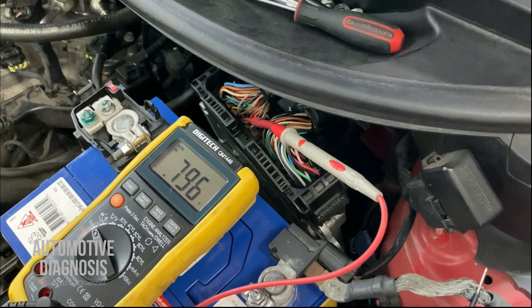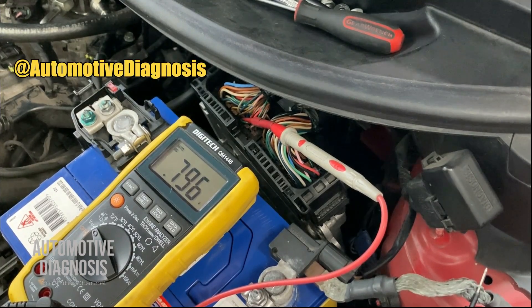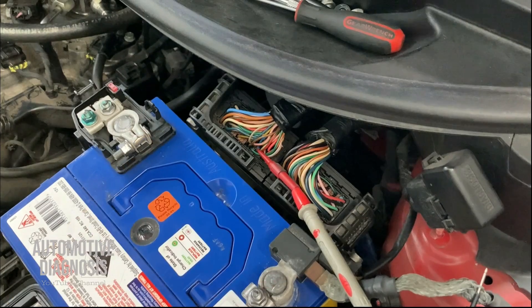If your voltage reading on the throttle body side was exactly correct, but when you check the voltage on the ECM connector it is different, it means the wiring between the ECM and the throttle body is not okay and you need to check and fix the wiring. But if the voltage at the ECM connector is also okay and you still read something different on the scan tool with the fault code still present, most likely your ECM is faulty. This is the step-by-step diagnostic process — check the throttle body first, then the wiring on the throttle body side and on the ECM side, and you can determine which component is actually faulty. I hope you enjoyed the video. Please visit the channel page for more diagnostic videos and subscribe to get notifications when we publish new ones. Thank you very much.